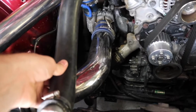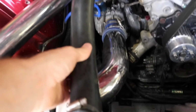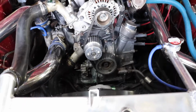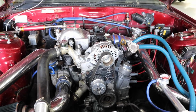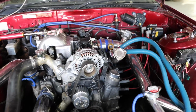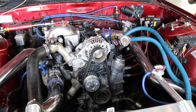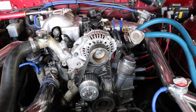So yeah, the diagnosis is suspected water seal at the very least. The water system, or the coolant system, gets pressurized super quick, and it has not started very well for a wee while now, so it looks like a rebuild is on the cards. So I'm just with Ben now talking through the options and trying to figure out what we're going to do. Obviously it starts and drives at the moment, but it might be a good idea to stop doing that and just rip it out now and keep the damage to a minimum.